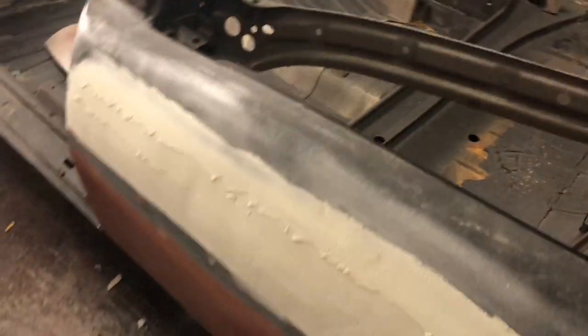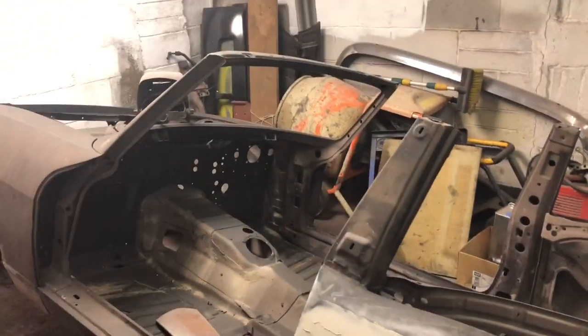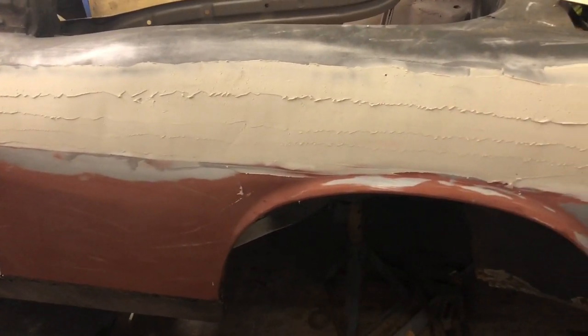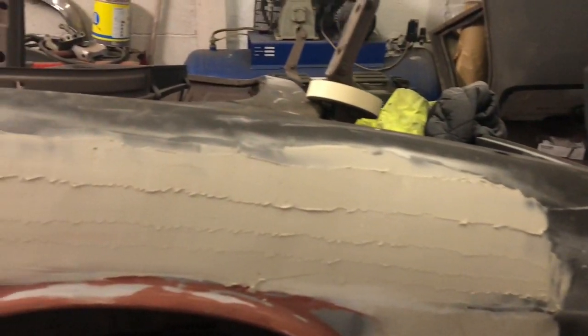I tried to get the angle. It's a guy called David who sent us some photos, because I found a blog on the internet that shows someone else's restoration with the car upside down. So with all the photos I've got now I can see roughly what you need to do. I've had to do the outer panel before I could finish off the inner because I had no idea what shape this last panel was. You had to get like a datum line or something so you can then match up to it - yeah, because otherwise I'd ended up sort of making up a panel and then cutting it back.